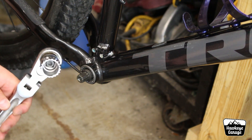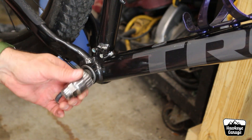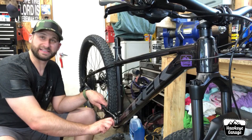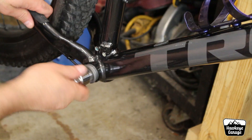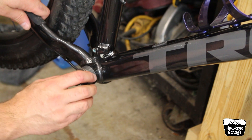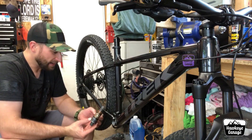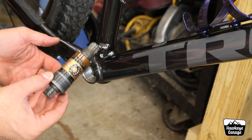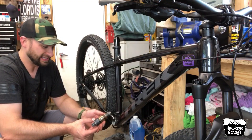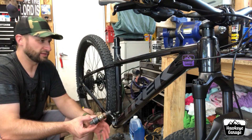This comes to our next specialty tool — this is a square taper bottom bracket tool. As far as I know, there's only one size and one style of that. This side is lefty-tighty, righty-loosey to get that bottom bracket out. I'm going to thread that out. It's actually in pretty good shape, pretty clean. I may go ahead and put these up for sale — the cranks and the bottom bracket, everything is in good shape. Since I wanted shorter crank arms, it just made sense to go ahead and upgrade all of it altogether.